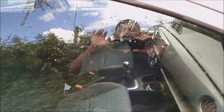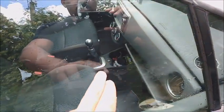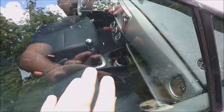I have to remove it with the 600 so I can continue the refining process using the 800, 1000, 2000, and if you have 2500 it will be good also. Just a hint, before you continue from the 600, which is the coarse grit, to the finer ones, if you leave any scratch now, it will stay. It will be decreased, but it will stay. So if you want to really remove everything, remove it now.